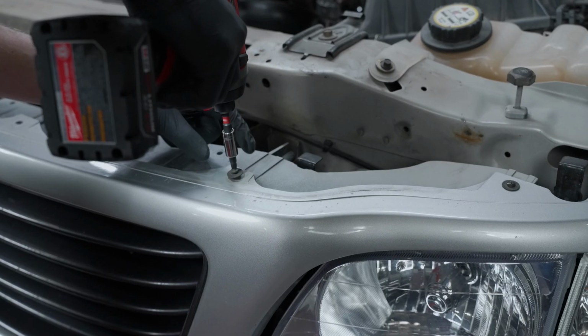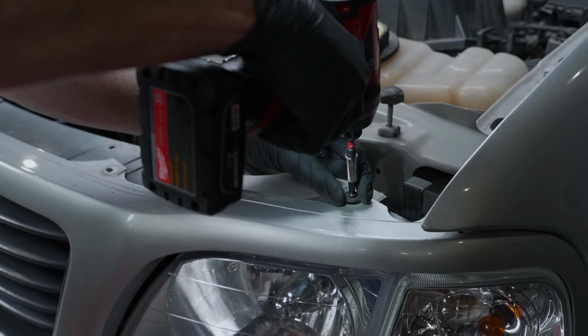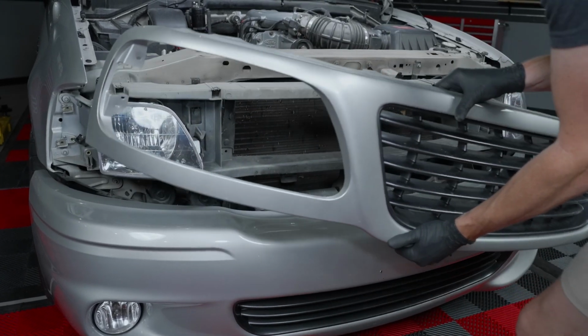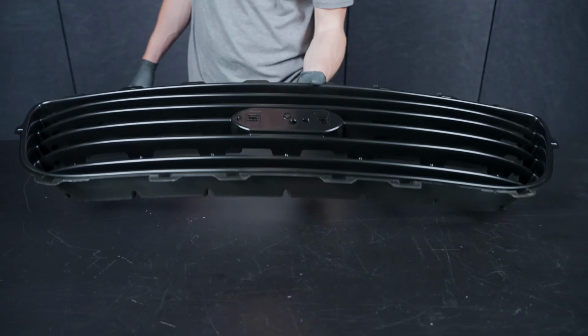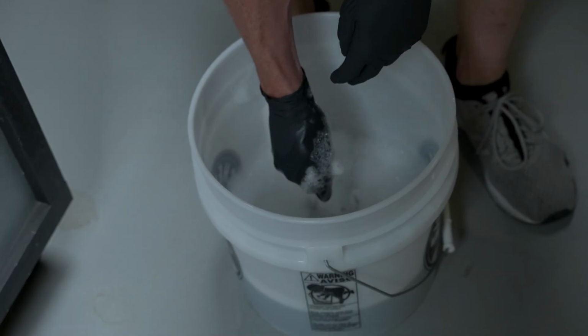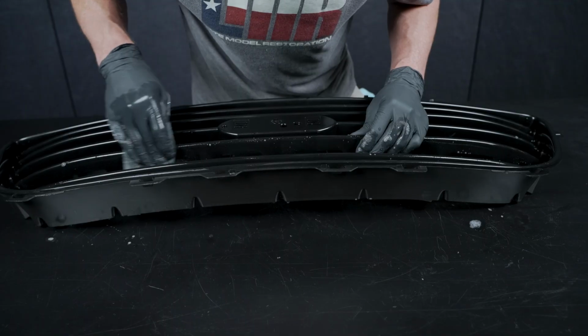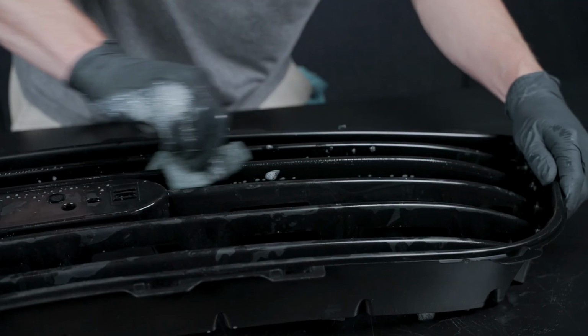For this video, we've already removed the grill shell and the grill from this 2002 Lightning. So if you would like to see how this is done, check out the video link in the description. First, we're going to prep and paint the new grill. Using some gray Scotch-Brite and warm water with a couple drops of dish soap, thoroughly scuff all areas of the grill that are going to be painted.